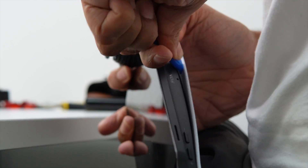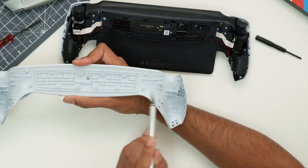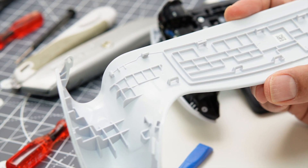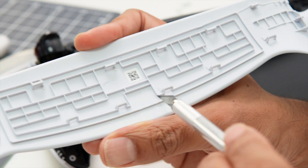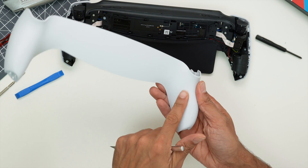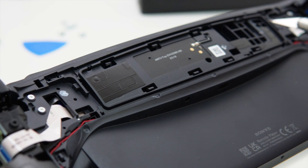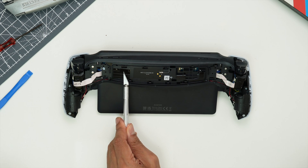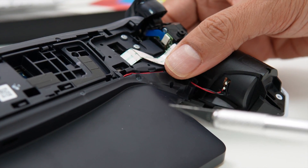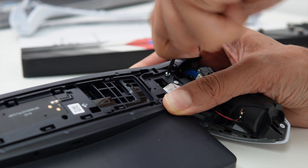Focusing on getting the back panel off now — making more progress, unclipping the clips all the way along, and we've got the back cover off. On the back cover you can see the pattern of walls, which provide structure. The wall sections are relatively thin because if they were too thick you would see sink marks on the cosmetic side — and flipping it around you can confirm there are no sink marks. There's an antenna on the back and some adhesive pads, likely to stop any creaking or movement. The trigger assembly shows the spring-loaded mechanism for L2/R2 and a force sensor for L1/R1. Lots of screws are now exposed, and we can also see some blue LEDs very similar to what you see on the PS5.